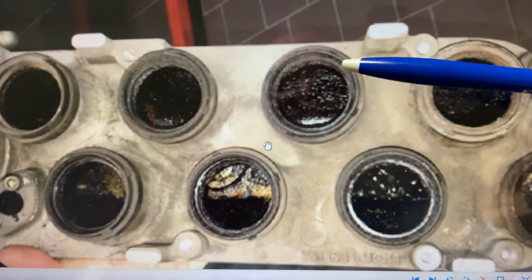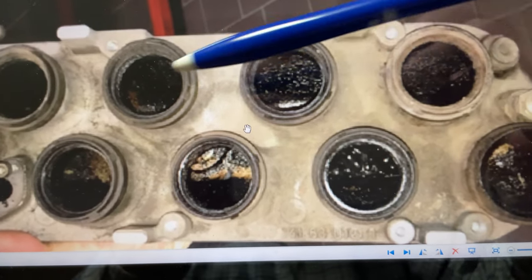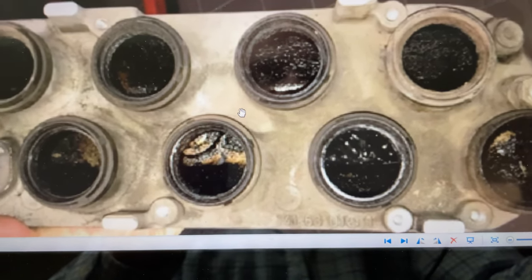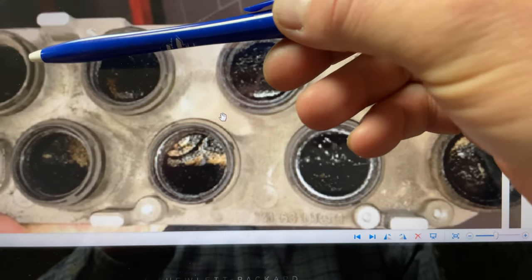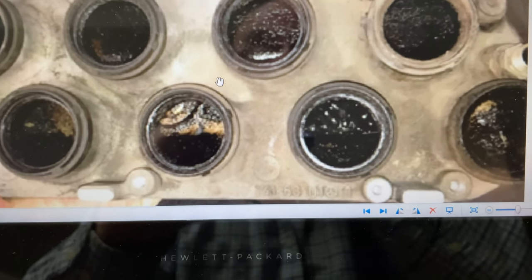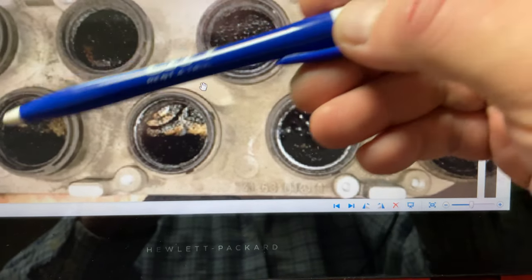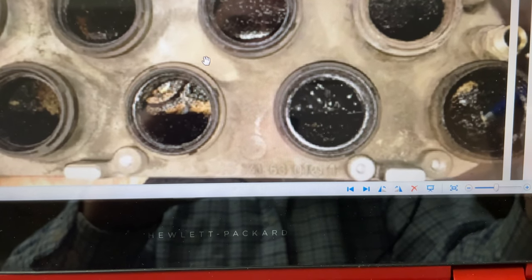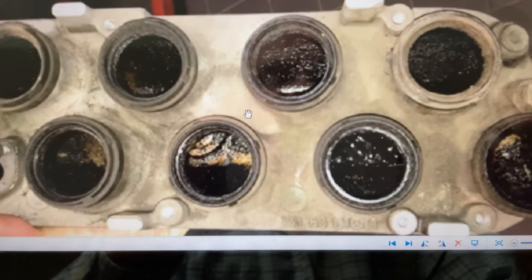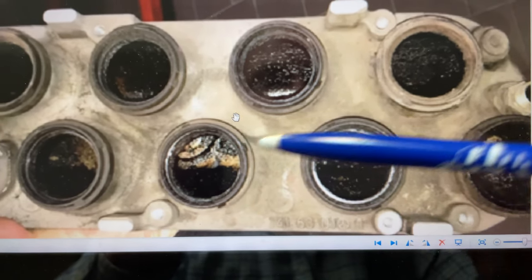There are eight o-ring gaskets here. Mercedes-Benz sells them for about nine dollars a piece — probably the best investment you can make. They're fairly easy to get to, but once you do they're going to be rock solid because they've probably never been replaced. If they're leaking, you're going to be bypassing air everywhere into the whole system and your idle is never going to work. Besides this, if you have too much carbon buildup from the EGR system, you'll need to have the manifold taken out and cleaned.